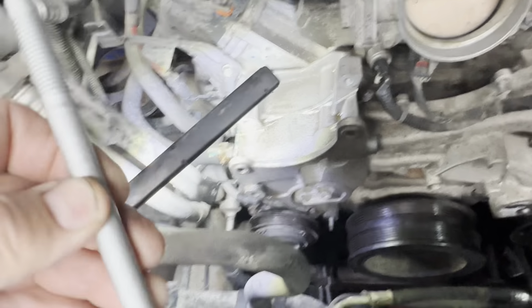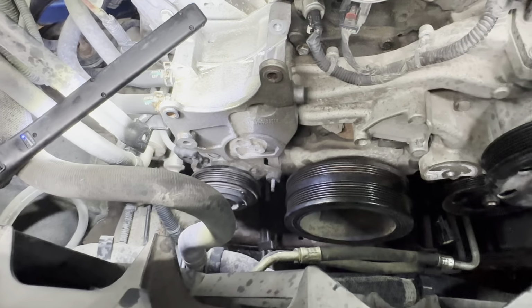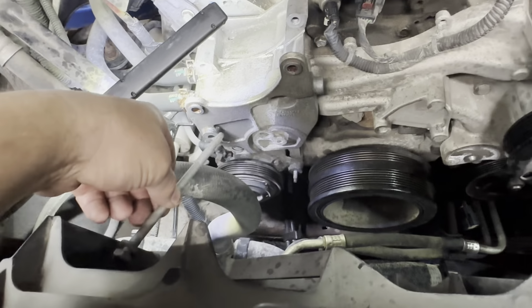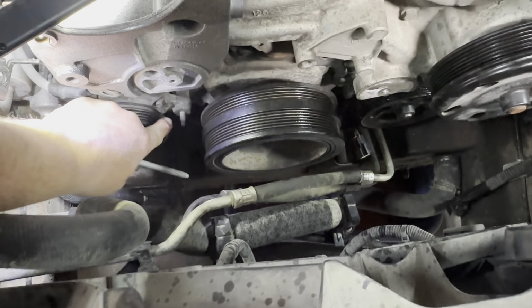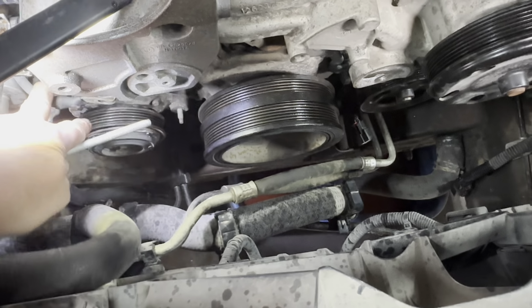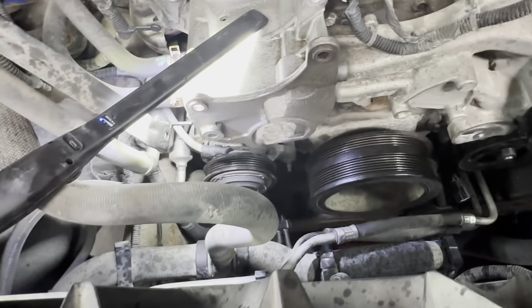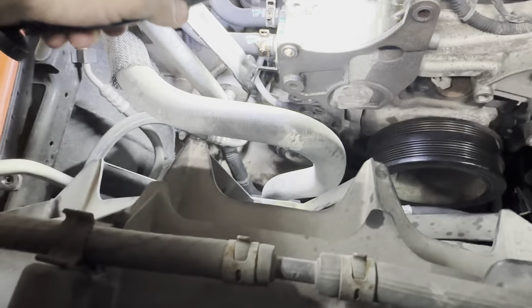Okay, got a 15 millimeter head bolt. Goes in here. All right. And you got a 13 millimeter head bolt. It goes in the top of the AC compressor. Over here, right there. Okay, and then you take that nut off the AC compressor stud. Take the 13 millimeter for the ground cable off. And there is no washer underneath it. No lock washer or anything. So next we're gonna go underneath and see what else is holding that bracket on.